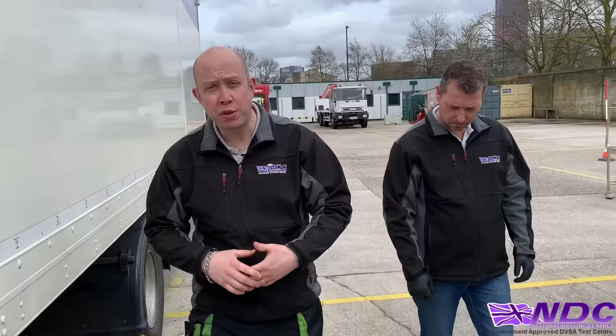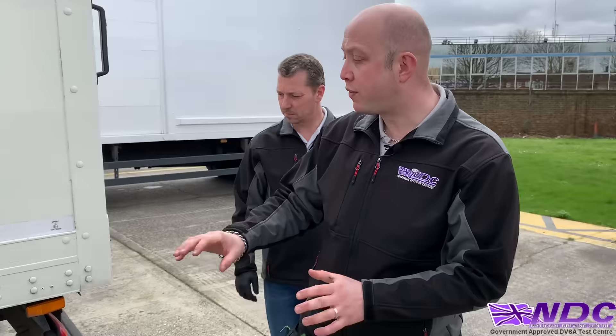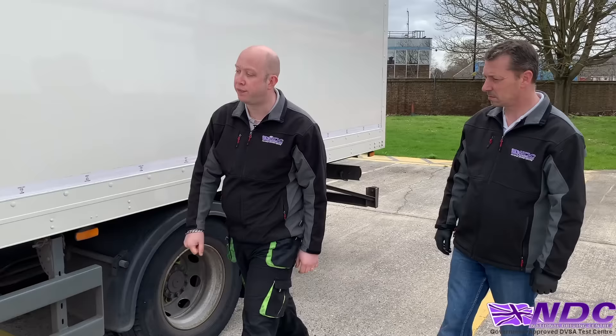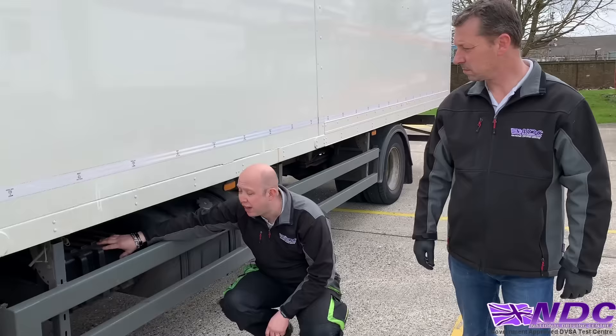More wheels and tyres down the other side — this is why a daily walk-around is so important: correct pressures prevent extreme heat. The fuel tank stores a lot of fuel on these vehicles, and leaks can start fires. Electrical fires can start in and around the batteries. Around the front tyres and around the transmission or engine. Inside the cab: fuses and electrical systems, radios, CVs, different equipment, day heaters, night heaters, kettles, and kitchen facilities are all common places for fires to start.